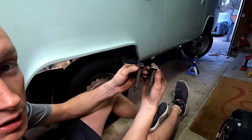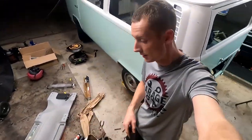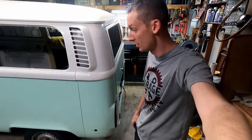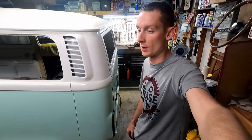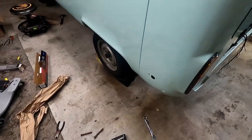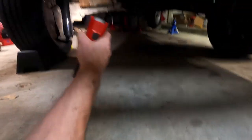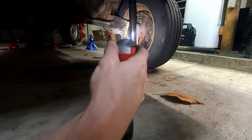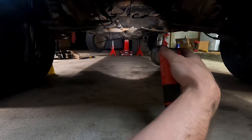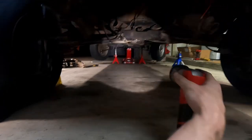Good news — we were able to go through a box on the shelf. That was only after we had gone to three stores and wasted our time looking for hardware they didn't have. Big surprise that American stores don't have much selection in metric, which is odd because most American cars use metric now anyway. We found a bunch of bolts that were very similar and luckily a set that were a perfect fit. The new shocks are now installed on both sides, nice and tight. Last thing to do is drop down the front end and give it a good push a few times to settle the shocks and compress them where they need to be.